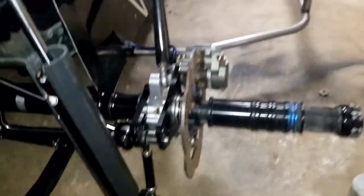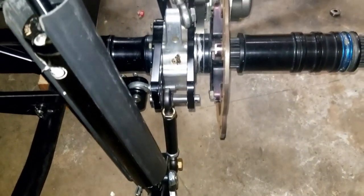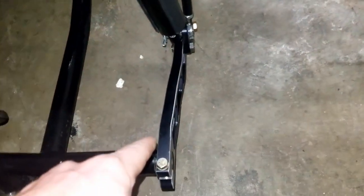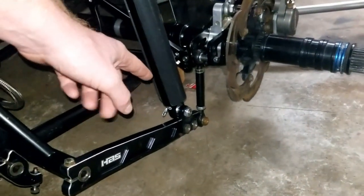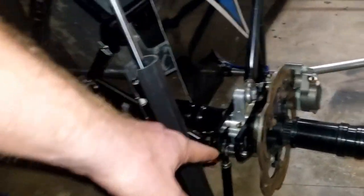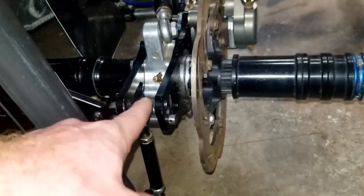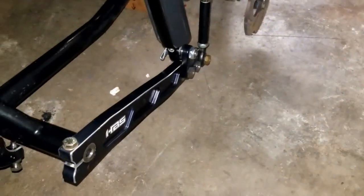You have your arms, your shackles, and your birdcage. So if we look at this one, this one's way off now. To fix that, you would either add or subtract the spacer in or out on the birdcage, or you'd bend this rear arm. In my case, I'm going to go ahead and take this arm off the car and bend it to get my angle right. I'll take the shock off the bottom, pull the pin out - all my shackles are pinned - for easy quick adjustments, then go back and check my alignment after I bend the torsion arm.